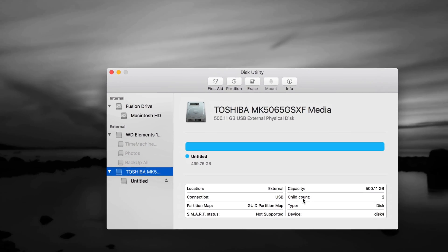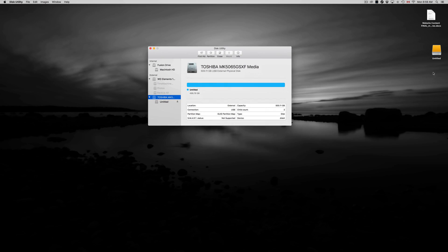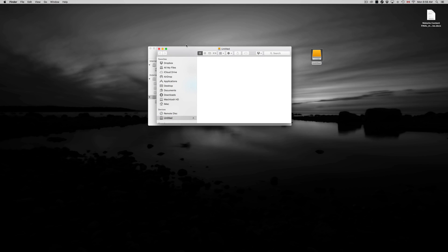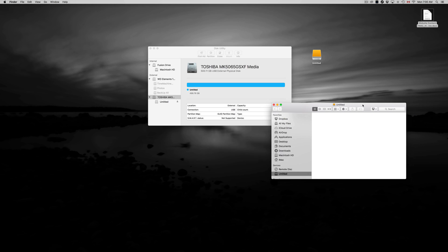Click Done once it's finished — that's your first partition done and right now it's only Mac compatible. Here's my drive icon — it shows as 'Untitled.' I can change the name just by clicking on it, pressing Enter, and typing a new name. But I'm not going to do that right now because we're not done. It's formatted with one partition and it's empty, so you can just drag and drop — like that, drop a file right in there. It works just like a huge USB drive.